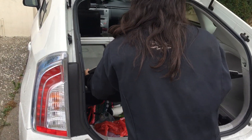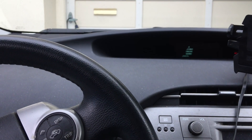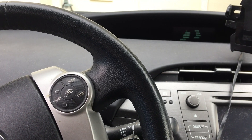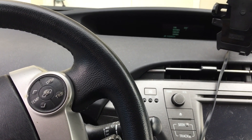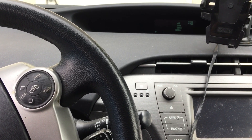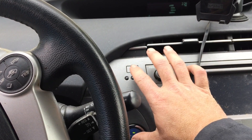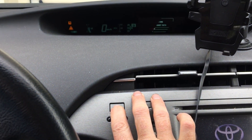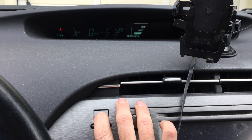We're coming back together here. Since we failed to reset using our very basic scan tool, we'll try and just do a maintenance reminder reset and see if that goes ahead and clears our message about HV battery cooling. So what we're going to do is hold this button and start the car. We're doing a maintenance data reset there — and complete.